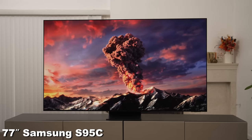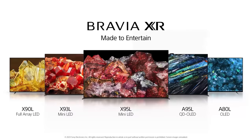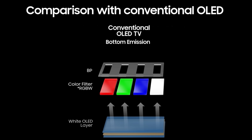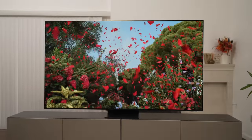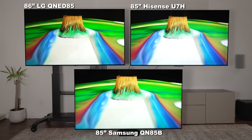So this is the first 77-inch QD OLED to market. Sony is going to have their A95L, which will be similar — it is a QD OLED TV as well, but they'll have two different models, and the Samsung one has come out first. QD OLED is quantum dot OLED, which is a little different from traditional OLED. Traditional OLED went from all three colors to white and back, and also added a white subpixel. With QD OLED, it just has all blue light, and then changes to green or red through a quantum dot layer, creating a very bright and beautiful image. Still pixel level control, and in my opinion better than backlit TVs.